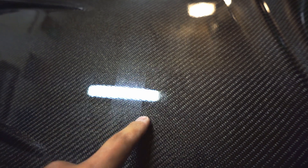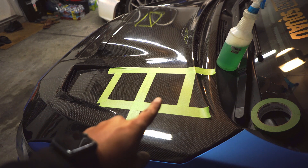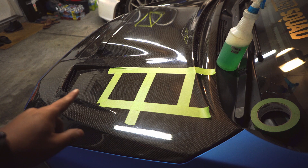Look at the big difference — we have clarity. You can see that, and we just did a small section — probably about a 30-second wet sand. Imagine if we did the entire hood. Now let's look at the whole wet-sanded section. Remember the bottom still had a lot of highs and lows, and going toward where we are now there's a lot of clarity. There are still high and low spots, and then right about there is where it's nicely sanded. For demonstration purposes I'm going to wet sand a bigger section, then polish it, and compare wet sanded, polished, and the original hood finish under the overhead light.